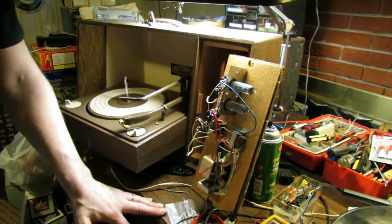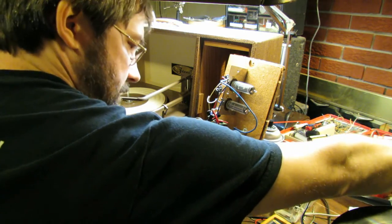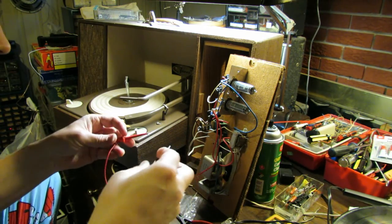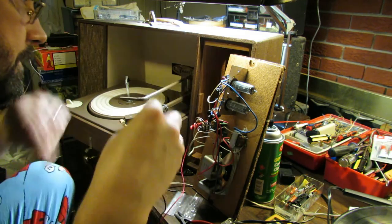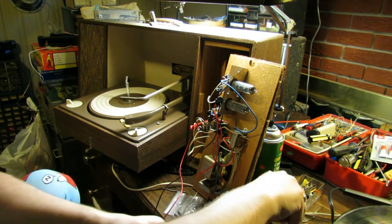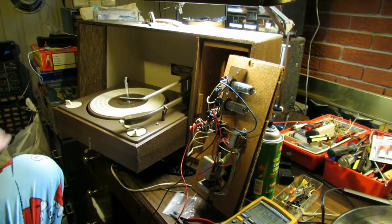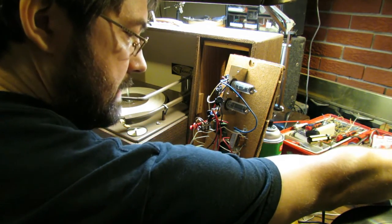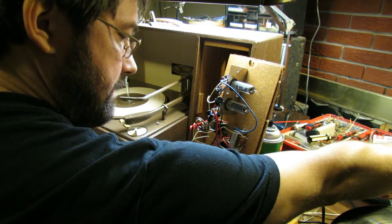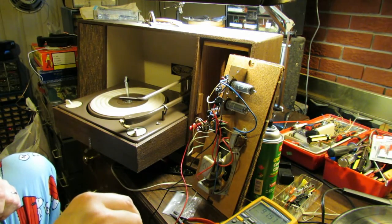All right, let's try that again. This time sans fire. Dial up the variac a little bit. I'm going to track the voltage on the other side of that resistor as we go. Okay, we're at 37.5 volts on the other side of the resistor. That smoked. There's 60 volts. 80 volts. Sorry, you're having a hard time seeing. I have to reach across to reach my variac.